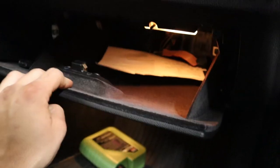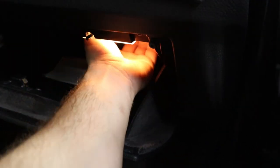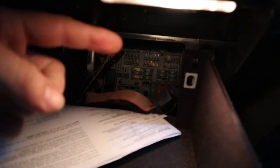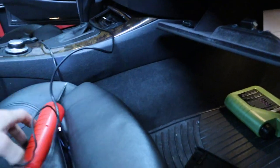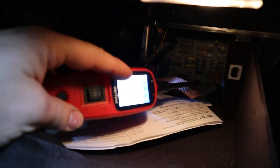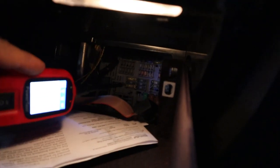On my car and most BMWs the fuse box is gonna be in the glove box, and you can see it right here at the back. There's a little plastic cover usually but mine is missing. We want to find out which fuse is for the cigarette lighter and test that fuse using the power probe, which makes it really easy because we don't have to take the fuse out — we can just see if power is getting to it and if power is going through it.